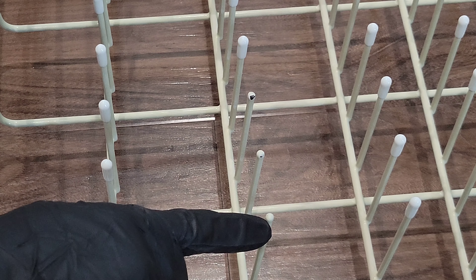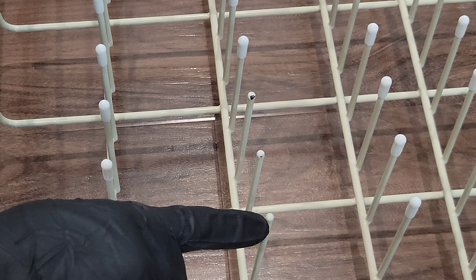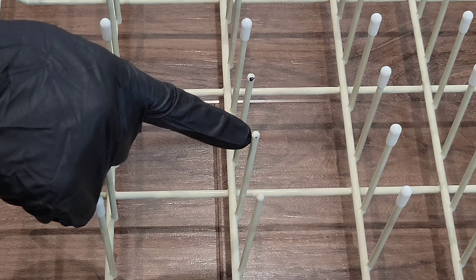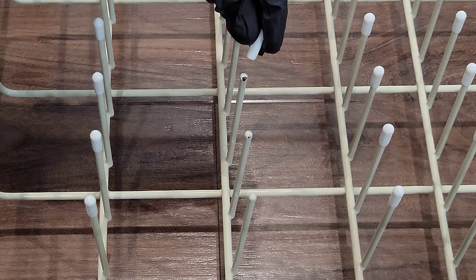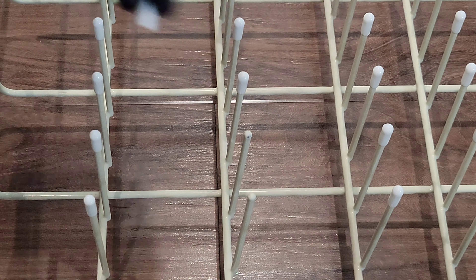On this prong, I did not notice any exposed metal, so I cleaned off the prong and then put a cap over the top of the prong to help prevent any future issues and to create a uniform look. I already have the rust removed from these two prongs and have already cleaned off these three prongs, so I'm going to reinstall the caps just so you can see what that looks like. When you do this, you just want to make sure that the cap is pushed all the way down.